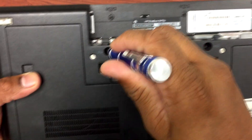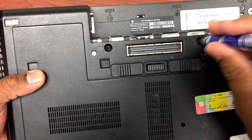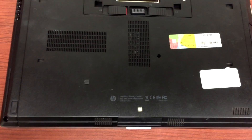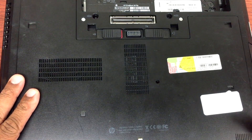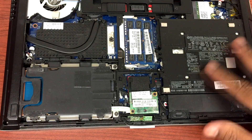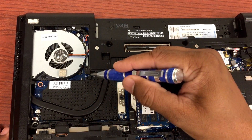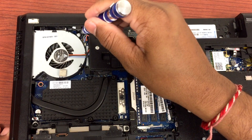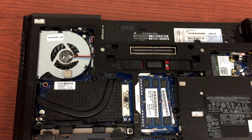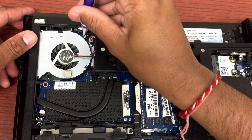Just make sure it's loose enough — the screw won't come out, just loosen it a bit and you'll be able to lift it. Now we'll open the back cover of this laptop. Next, we have to remove three screws from here: one, two, and three. Same thing — if the screw won't come off, just loosen it up a little bit.